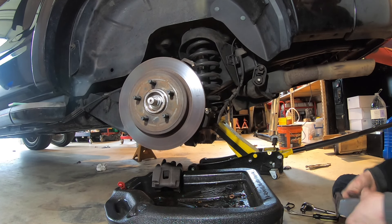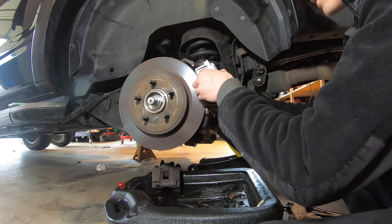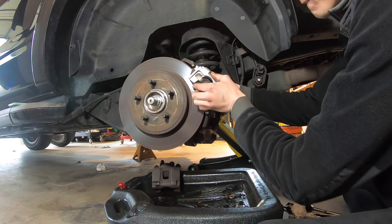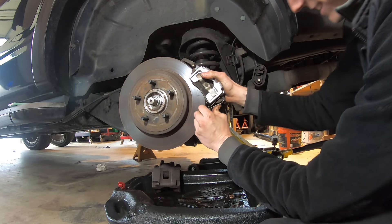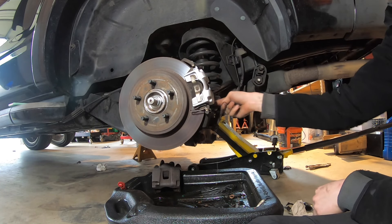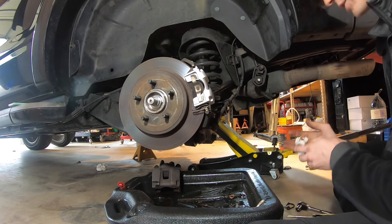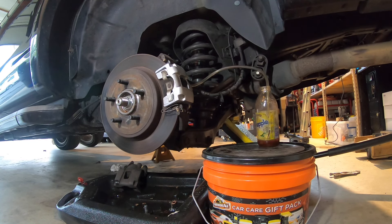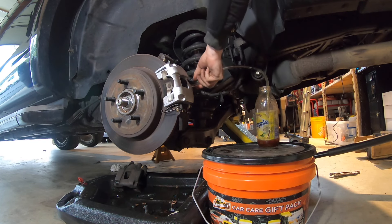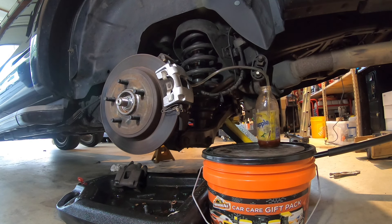The wind is really not conducive for recording today. I'd almost be able to fool you and tell you these calipers were new — new to me. The top hooks in, bottom hooks in. Two bolts. Once again, I get my one-man setup: got the bleeder loose, got the hose up into the Snapple bottle with the fluid in it. I put more fluid in the master. I'm going to pump the pedal 10 times — really should be good to go. I'm going to keep doing it until the fluid comes clear.